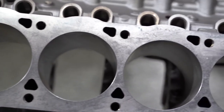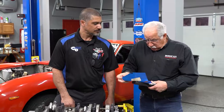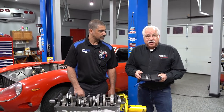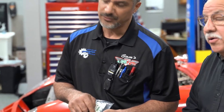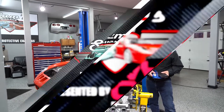I had my very trusted machine shop — I've been working with them for 25 years — do all the clearancing and inspect this motor for us to reassemble with no issues. If you don't have that and you're doing this at home, you need to have the right tools. You'll need a set of micrometers to measure the crankshaft and tools to measure the bores, or vernier calipers, to check all your clearances from your crankshaft to your rods to your bearings. If you don't have those things and you want to do some checking, that's where Plasti-Gage comes in. They've got them from 0 to 3, up to 6, and blue goes up to 10. You take a piece, put it across the journal, put your rod cap or main cap down, measure it against the package markings, and it'll tell you your clearance.